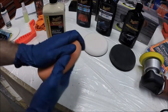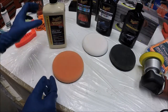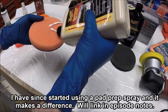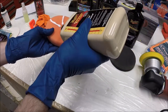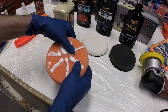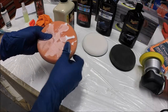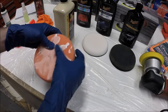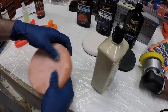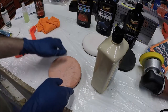Step one with the new pad — even if you've used these pads before, we still want to prep the pad for the first time we apply the compound. It's just a matter of working compound into the pad with your hands so it's not going on bone dry. Wear some gloves because it's a little messy. Just work it in for kind of an even distribution. This way, when you apply your compound and you're ready to buff, all your compound doesn't get soaked up by the pad.